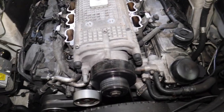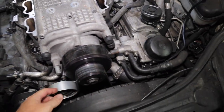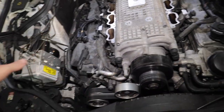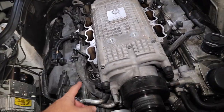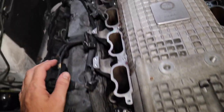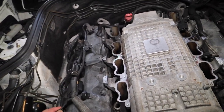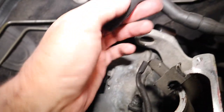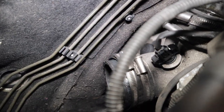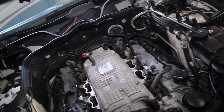We're going to keep trucking on. I'm going to start by taking the supercharger belt off, undoing the coolant lines for the intercooler, and undoing this little brace. My setup is a little different since I don't have the secondary air pumps, so mine is just an allen head right over there. We made a little bit of a fuel mess. We're going to start undoing the supercharger — make sure you undo your lines, disconnect your MAP sensor plug, your air intake sensor, and keep track of where the plugs are routed.